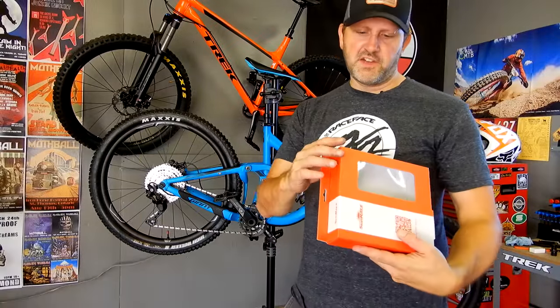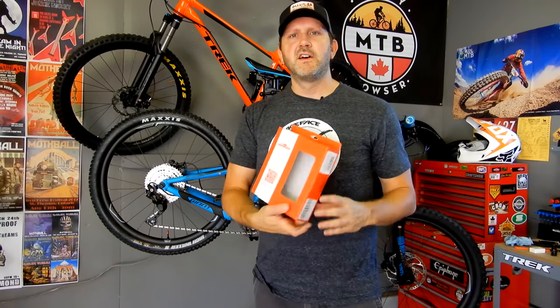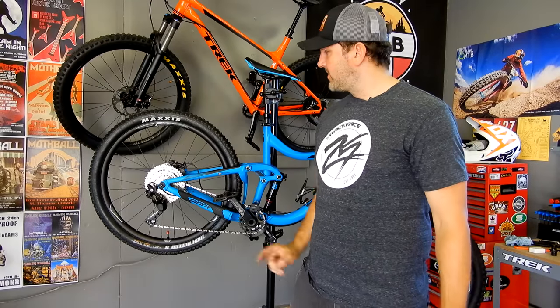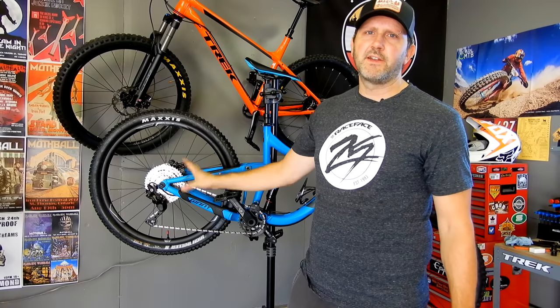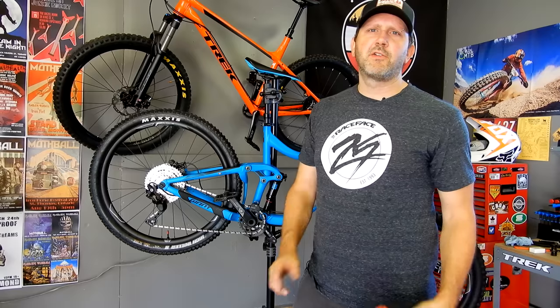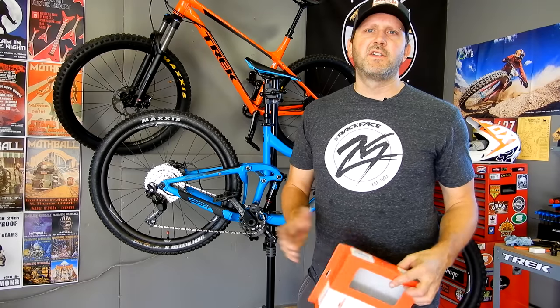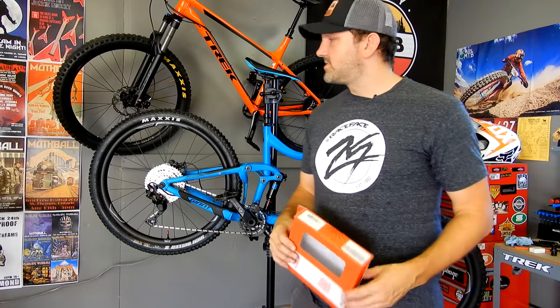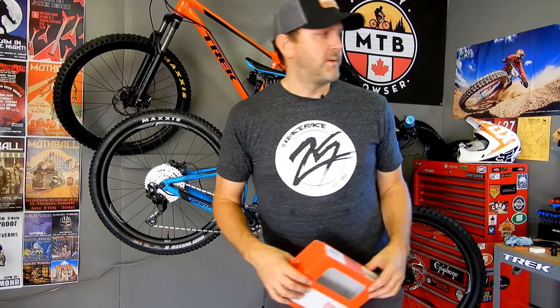So there you go — I got the new Sunrace CSM X3 11-46 10-speed cassette on the Rain installed. It seems to shift fairly decently. I might need to adjust the limit screws, may need a longer chain. I'm going to compare it to the Roscoe here shortly and see what the chain angles are like on the derailleur. I think it's so far so good. Going to take it for a spin and see what it's like. Don't forget guys — subscribe and like the videos, really appreciate all the support. Tugie Hauser MTB, keep your feet on the pedals!